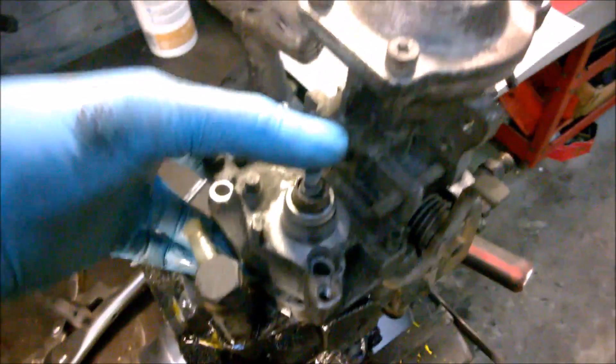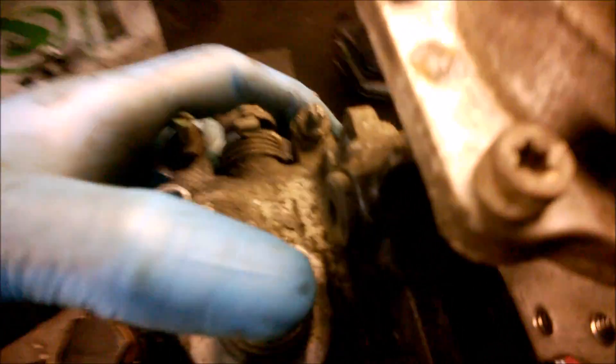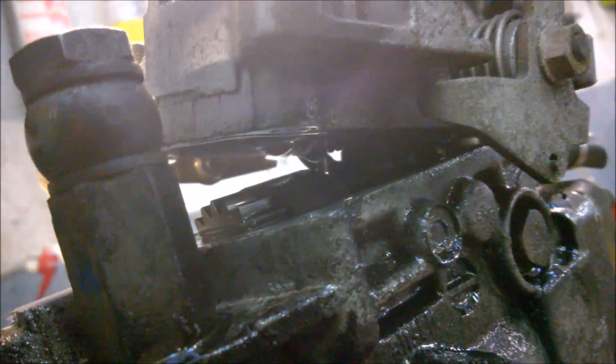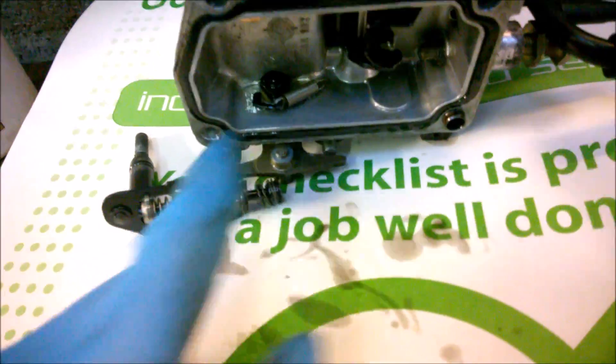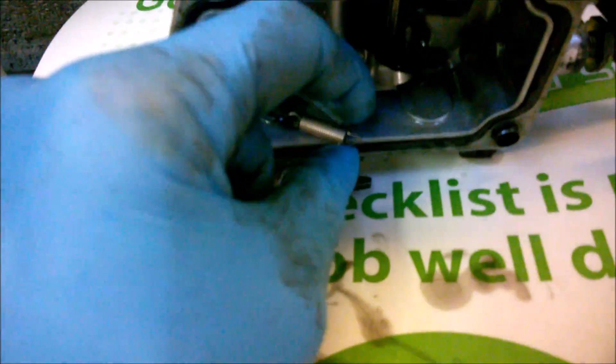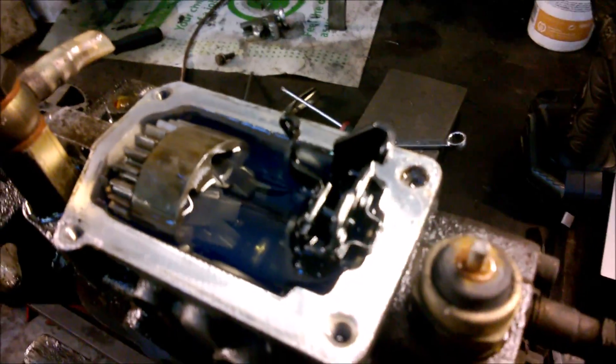Don't try and pull it off. The way I do it is I push that down with my thumb — a bit of force and it comes off there. And then if you look underneath, there's a little spring that needs unhooking; I'll show you once it's off. So the top's off. There's your governor assembly, the governor cradle and everything. That little spring there hooks on to this little bit here. I'd advise keeping it on — it's your hot/cold start idle mechanism.